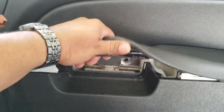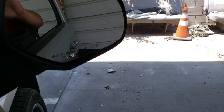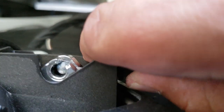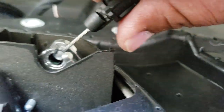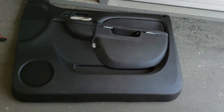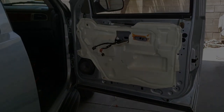Work it loose all the way around, then slide it up. Once you pop that all loose, you can see why we're replacing it — pieces are falling off. Pick it up and out. There's a cable here we have to release — this pops out, might need both hands to open it up. The door is already broken, so now we're going to install the new one. That's how you remove a door on a 2015 Chevy Tahoe.